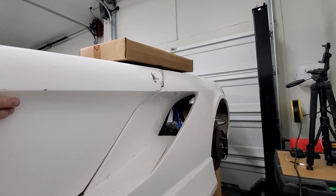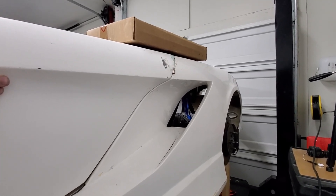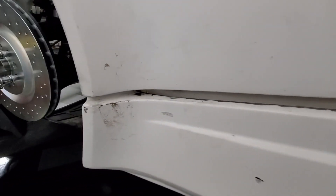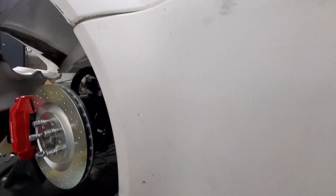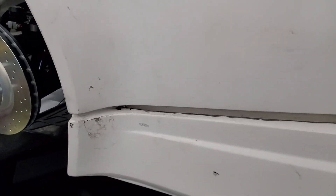All right, this one I've got the top aligned. I've got a wooden spacer there to get a good panel gap. That's a good spot as it comes down — not too bad at the bottom, but then it goes from a little to a lot and kind of back to a little. I can maybe drop this down just a titch, but the back is where we want it. I did a measurement there and it matches up top, so I'm thinking this is about where we want it.